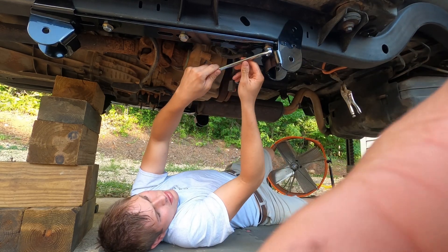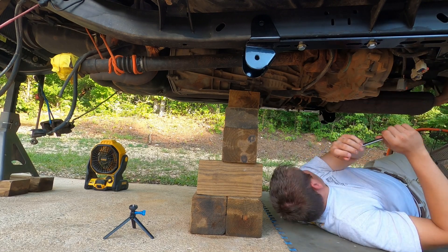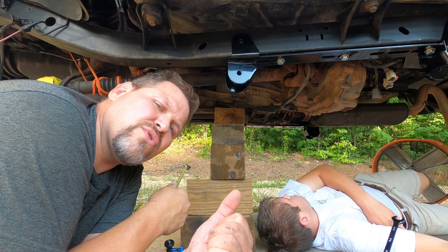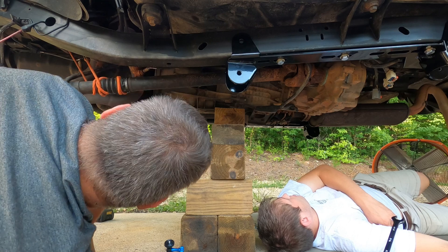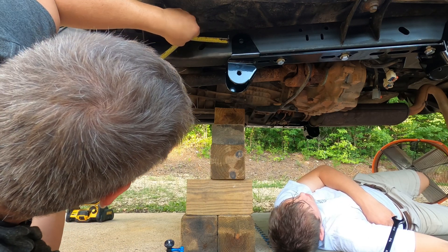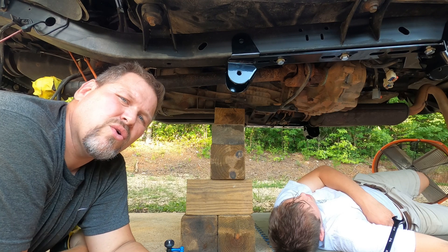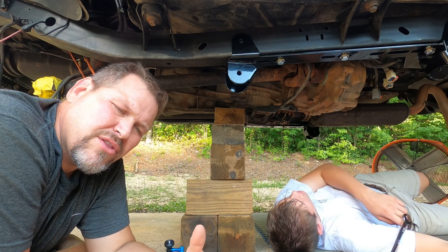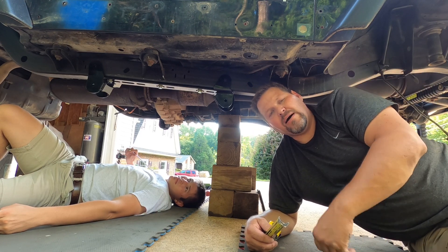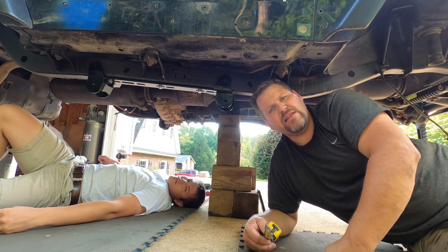What I'm going to do is find a spot in the frame and take a measurement — hand me my tape measure over there. Now that Harley's snugged up those bolts, I'm going to take a measurement here so we can transfer that measurement over to the other side. Three and a quarter inches. So let's go over and check out the other side. We're over here on the passenger side of the frame. We already threw this frame saddle up, somewhat centered it, and Harley snugged it up.